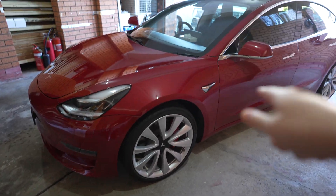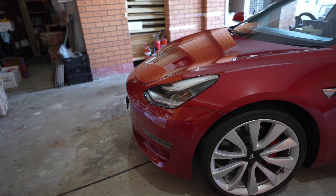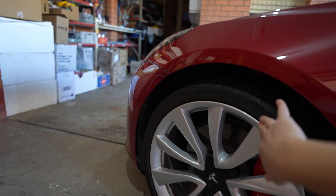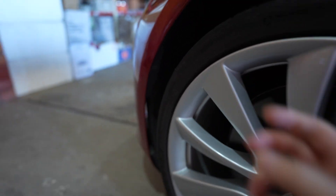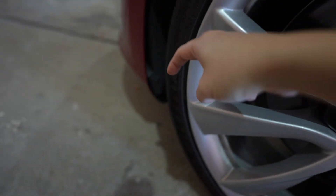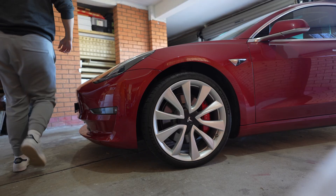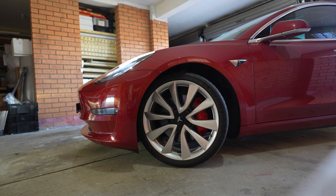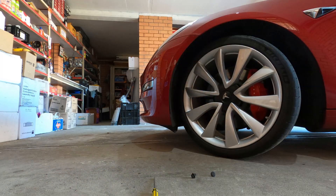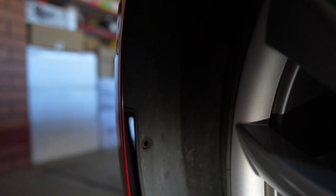Now that we know the computer can talk to the car, the first thing we've got to remove is the bumper. To get to the bumper — I'm not going to go into full detail because I have another video about removing the front bumper — but basically we need to turn the wheel inside so that we can reach the clips and pull out the fender lining a little bit to reach the bolts up here. There are three bolts that go up and one bolt that goes down, holding each side of the bumper. There are also three little plastic rivets that go into the fender lining.